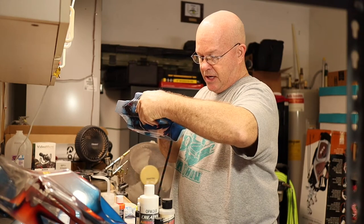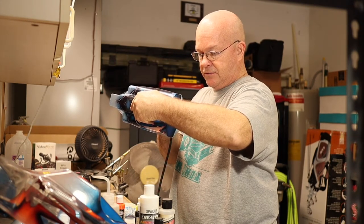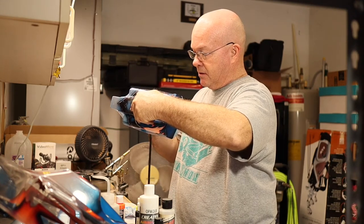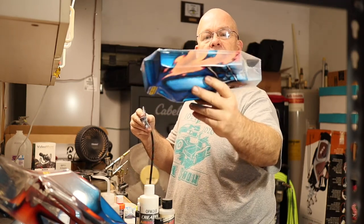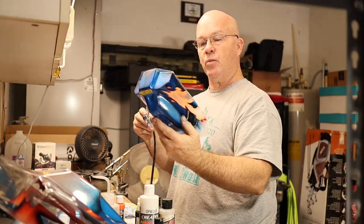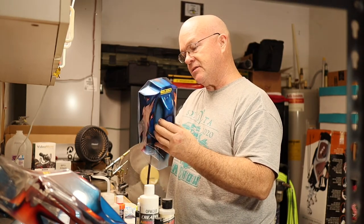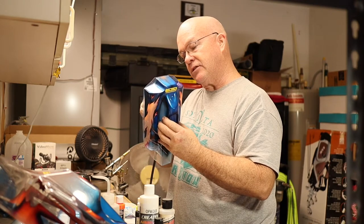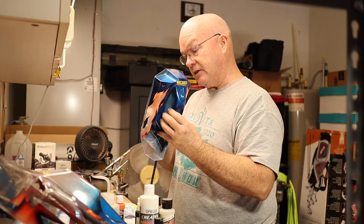I'm just going to do it on the edge, aiming about an eighth of an inch into the work surface, the amount of overlap I want. Very transparent. You don't want to try to lay it on in one shot, just like when you first start the paint process. Every time you're on bare wet sand, you gotta go back to the light first coat. It's not the finished product at all at this point.